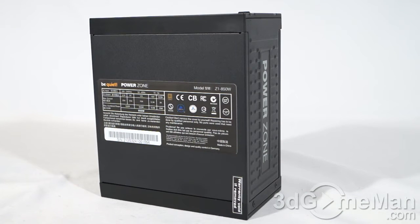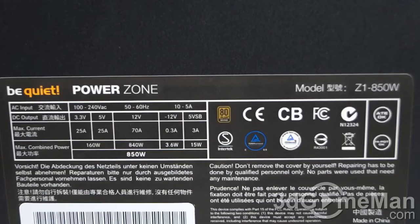Fourth, I'd recommend choosing a power supply that has APFC. APFC, or active power factor correction, assists the power supply in being more efficient and therefore stable under load. APFC basically reduces total harmonics, it corrects input voltage, and it allows for full input voltage range. Thankfully, this power supply has APFC. Fifth, there are three main certifications: 80 Plus, NVIDIA SLI, and AMD Crossfire.